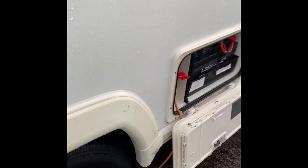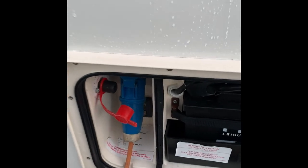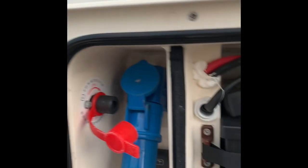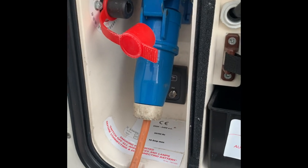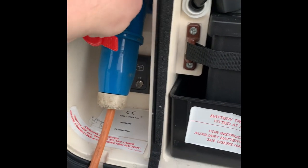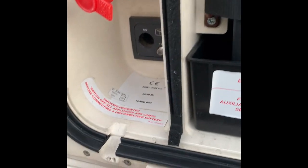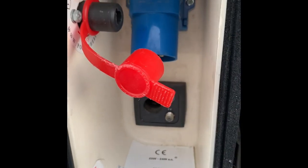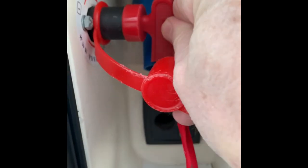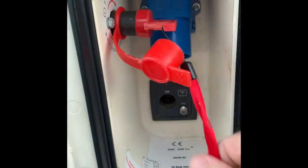The battery box houses the electric hookup. As I showed you briefly earlier, this part is the isolation switch for the mover. We do need to take the electric hookup out first. For the motor mover itself, there's a little red key that goes in where there's a little cutout — push that in and twist it as far as it goes. You now have power to your motor movers.